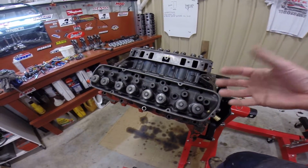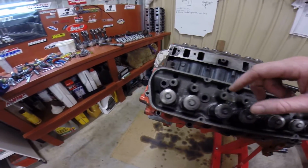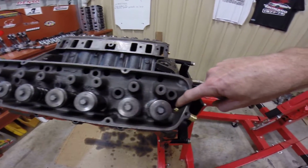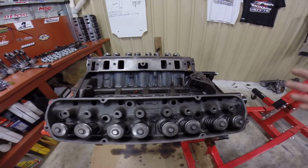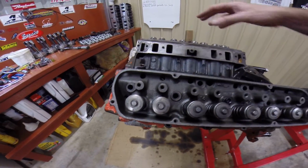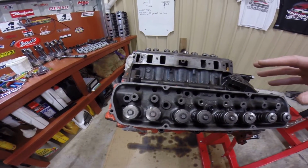The heads are filling up through the push rods, flooding the tops of the rocker covers, and we only have tiny holes, if you can see down in there, which are not enough for the oil to return back into the sump. Now what's happening too is you've got a certain amount of pressure coming up from the crankcase, because I have a breather either side of the rocker covers, but I have two in the manifold as well, which has helped, but it still presents a problem.